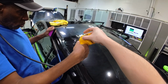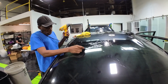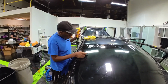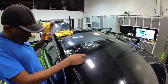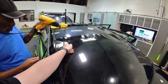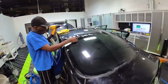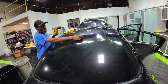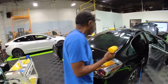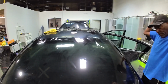Yep, nice, right like that, perfect. Now take that, push that all forward. Good pressure, yep, that's nice. Hell yeah. Yep, you're good. If you wanted to put a little more heat right there, but you're right past the edge. So either way, you're golden. Nice. That's exactly how you do it. We'll wrap up this corner, and you'll have a shrunk back window.